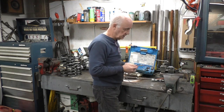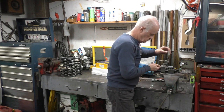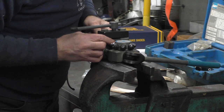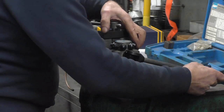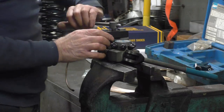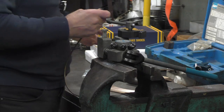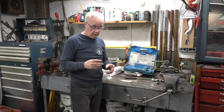I'm making up the brake line with new fittings and a piece of brake line pipe. I have a flaring tool here. I do my single flare first, then my double flare. You can see the flare on the end — that's nice. Now I'll do the other end. I've got all the Triumph parts ready to go back on. I'm going to finish the brake line and carry on with the front suspension.